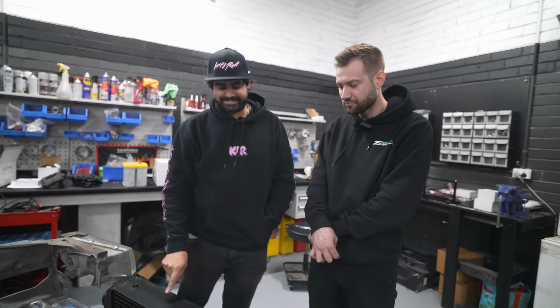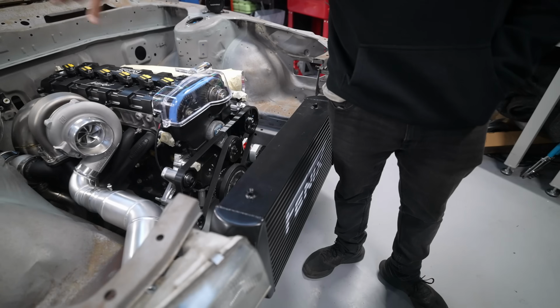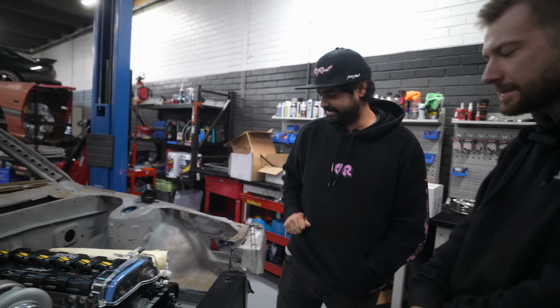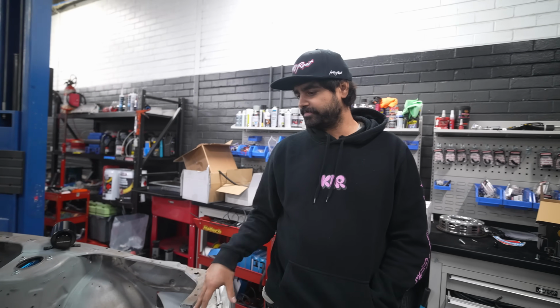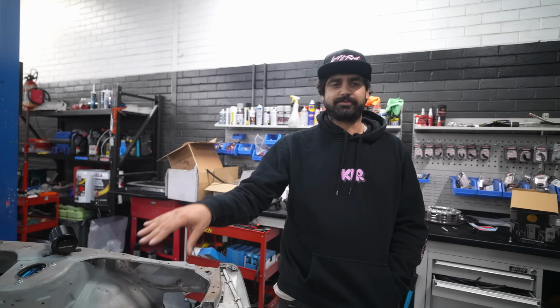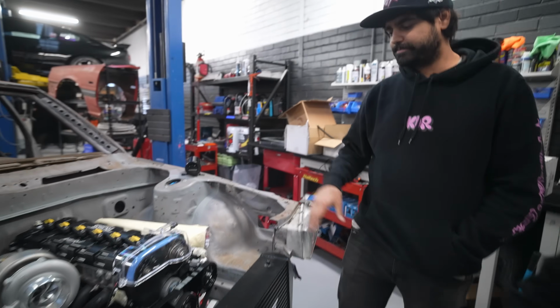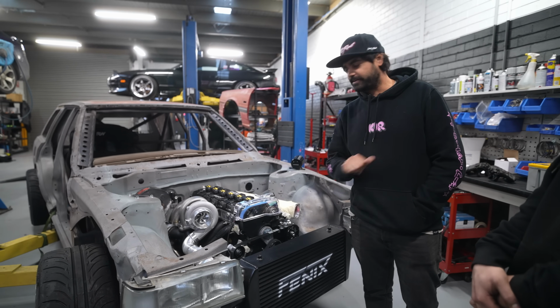I feel like I've got to touch on this cooler because it's hectic. So basically I feel like we can get away with whatever heat the turbo might have created will now be dissipated entirely, because I've heard of people, when they start cramming too small turbos or inefficient turbos, you start getting hectic intake temps and people normally run not this big of a cooler, but I want to make sure we have none of those issues.